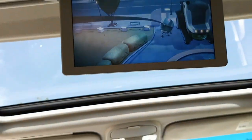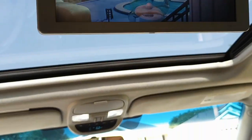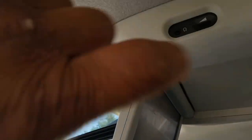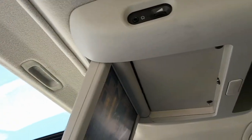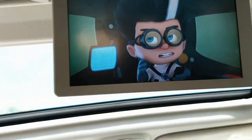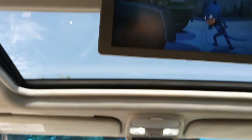My kid's complaining that the sound is not really working on his little entertainment center. I did some research and found out that you just have to clean the little dial for the volume, because the player works fine. The issue is when you turn the dial, the sound goes the opposite direction — dial up, sound goes down and vice versa — or it just cuts out completely to one speaker.